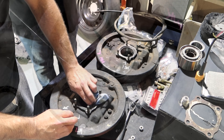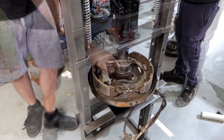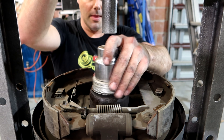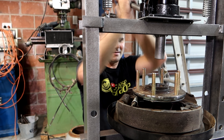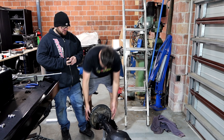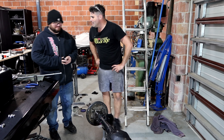Now, because we are using the shafts made for the newer ML Triton, we don't know if the MK hubs are going to work. So we are pulling both models apart to see which hubs are going to work for us. After some playing around, we found that the ML shafts will only work with the ML hubs. The downside of this is we don't know the condition of the bearings in the ML hubs. So what this means is we have to chuck in some new ones so we don't run into problems down the track. And it was all going super smooth until this happened. Let's slide this in, Ben. No point. Why is there no point, Ben? It doesn't fit.